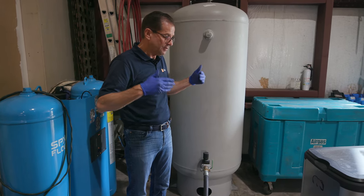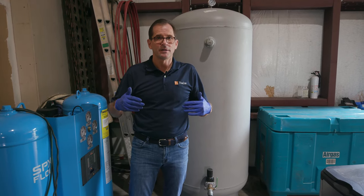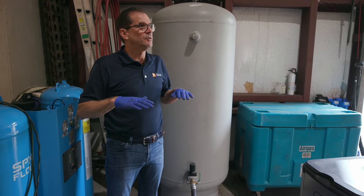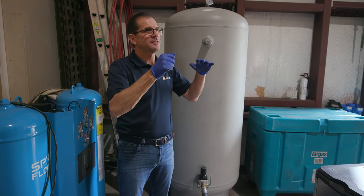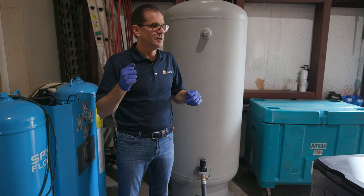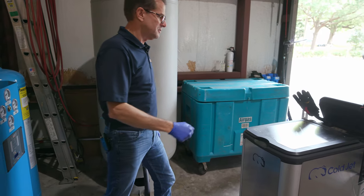All right, so now, if we've done everything right, we've got 125 or more CFM, cubic feet per minute, and we have up to 125 PSI, and it is so dry that, well, you'll see, because we'll have some ambient moisture issues, and I'll shut the dry ice off, and you'll see how fast this thing dries, like a leaf blower or that stuff you can buy to blow your car off after you wash it. It doesn't hold a candle to the volume of air that we have that's super dry, and we'll dry off the surface you need. So now let's get into the beast.